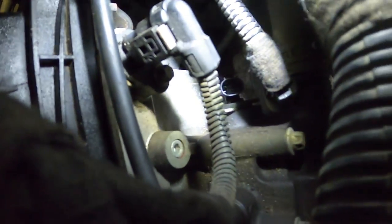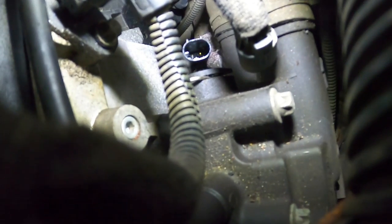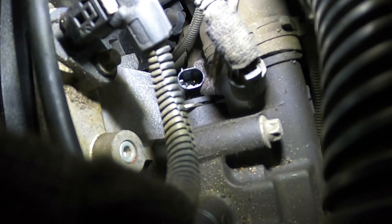right, so the sensor is there. You can see the sensor right there. There we go. That's pretty good. That's a pretty good video. So if you look, there's a sensor. And now what I'm going to do is have a little screwdriver. So there's a sensor there, and the clip that you've got to pull out is this clip right here. See that clip? And it just literally lifts up, pulls out, and that sensor will then exit in this direction, and there's a little O-ring. You've got to make sure you fish the little baby O-ring out.